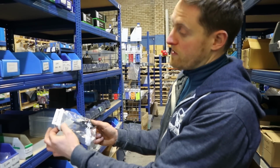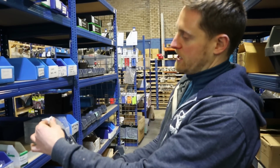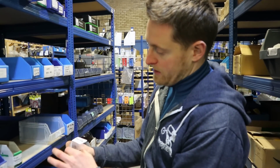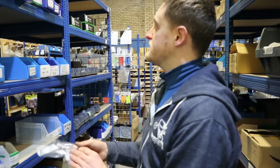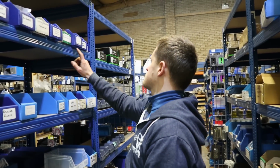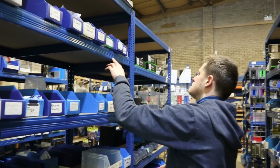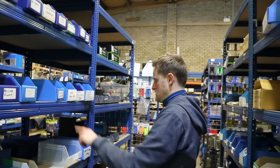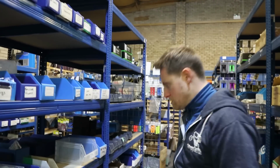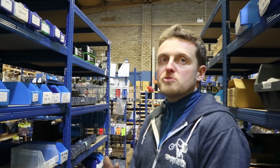But that mounts over your rear axle, so you clamp it between the frame and the hub. So you've got all the articulation you need. Little bit of chain line adjustment on the slot. Pretty neat. You're also wondering about possibly using one of the double wheel tensioners we have, the spring tensioner, or? Because I think the frame's got 375mm chainstays, which kind of, I don't know how baggy that'll leave the chain with a 22-18 ratio. Maybe we should put the chain on first and see how it looks.